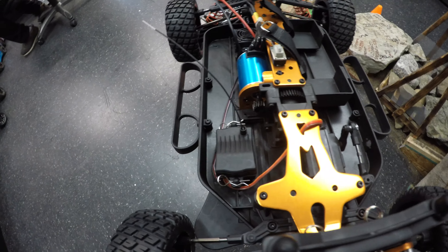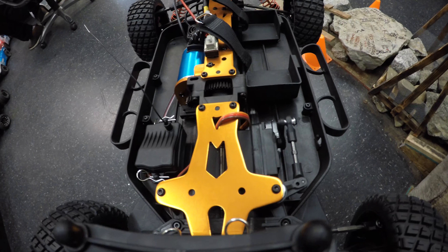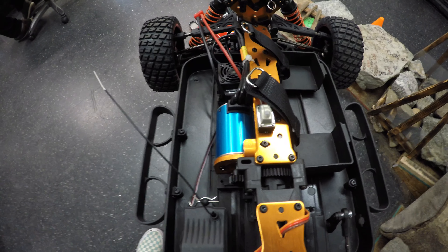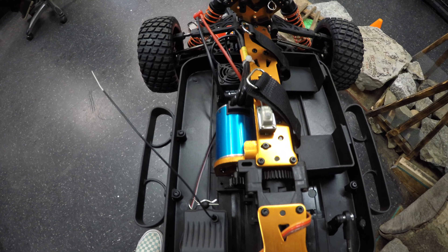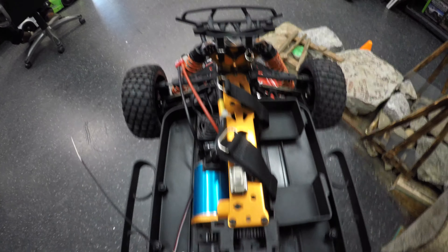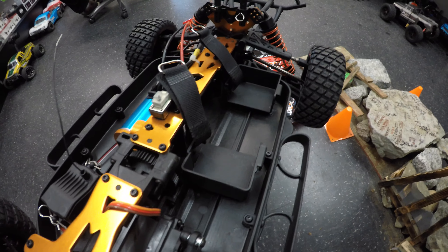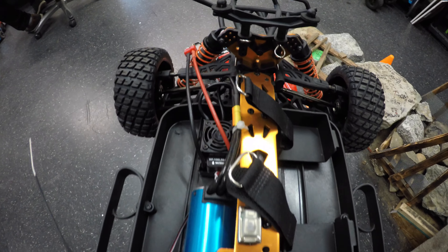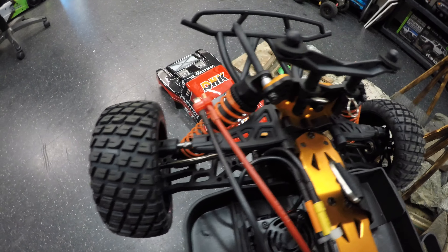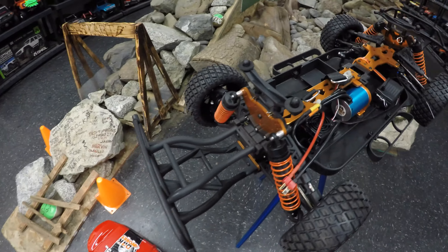Note that horizontal metal brace inside the chassis — that bodes well for this car. We've got a waterproof receiver box on the left, and the car has waterproof electrics all round. Steering servo on the right-hand side. The motor is mounted very far forward, which is going to help keep the nose down and limit its chances of wheelying. The car is fitted with a 50-amp ESC and a Deans connector. The Hunter BL features a 3,900kV brushless motor powered by a 3S pack on the right-hand side, and we've also got an aluminum brace running down the center at the rear. The upper A-arms look a little on the light side, but that helps keep the weight down on this car, which weighs just five and a half pounds.